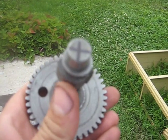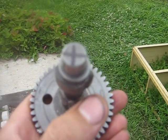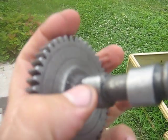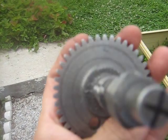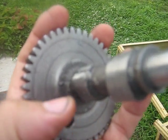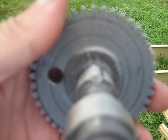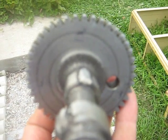This lobe has about a hundred thousandths lift on each side — I believe that's probably less than the stock Briggs. And if you look at the second lobe here, that's the air inlet lobe, and it only has thirty-five thou lift. So you can see it's hardly any lobe at all there — like one line of weld ground down.